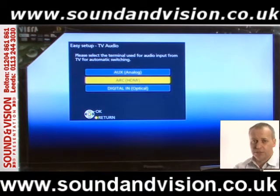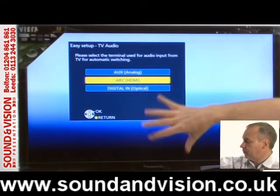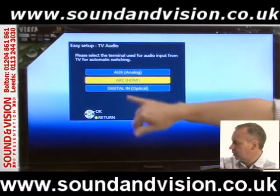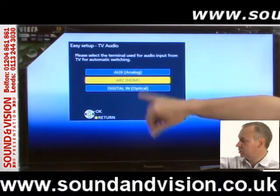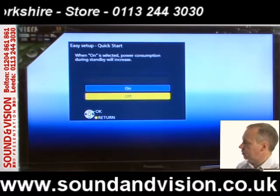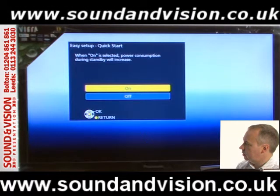If you've got a slightly older TV and doesn't give you the option of the ARC facility through the HDMI, you can output the sound from the TV auxiliary, which is the standard red and white sockets, into this unit, or digitally using the optical connection. So you just select accordingly. On this one, we've got it wired up with the HDMI for ARC control, so we'll just press OK. We'll just switch that on.